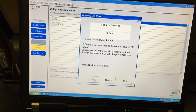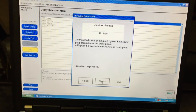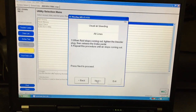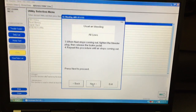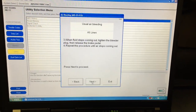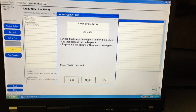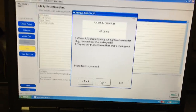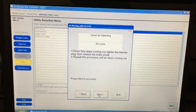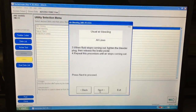Have your helper depress and hold the brake pedal, loosen the bleeder valve, let a tiny amount of fluid out, tighten it back, and repeat — maybe 20 times — to get sufficient fluid volume and ensure no air remains. You could leave the bleeder valve open and have the helper depress the pedal several times to move fluid more quickly, however a vehicle stability control fault occurred when doing that, so follow the steps exactly as described.